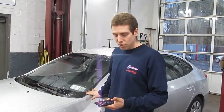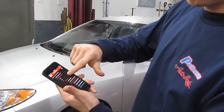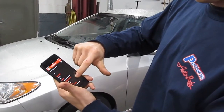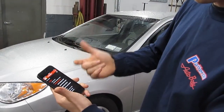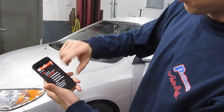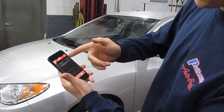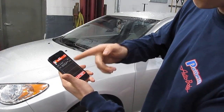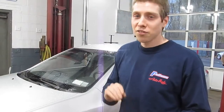Here we have a 2008 Hyundai Elantra. I have access to all the different modules in this car: PCM, transmission computer, SRS, BCM, and anti-lock brakes. If I click 'Read Trouble Codes' on the ABS module, it found a C1203 for a front-right sensor — open or short — because someone doing a wheel bearing broke the sensor. They're tough on these Hyundais, so if you ever do a bearing, you might want to sell the customer on a sensor as well.